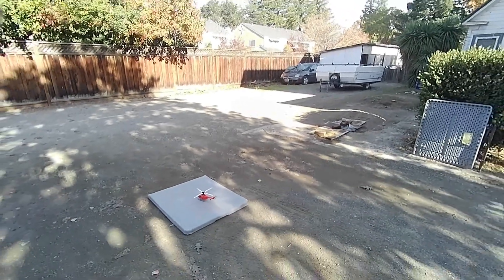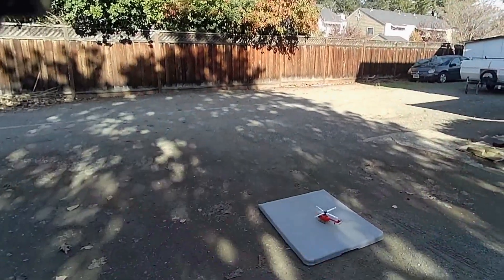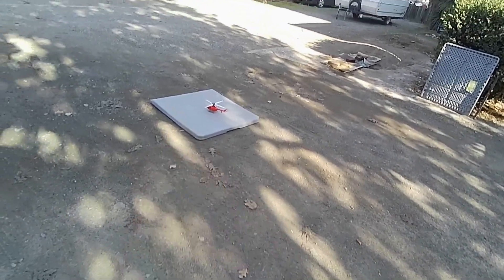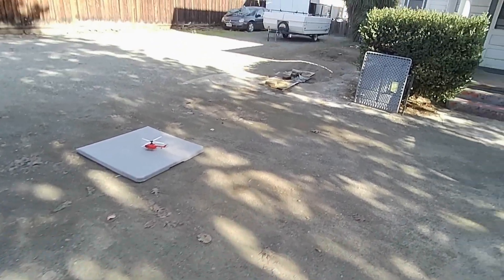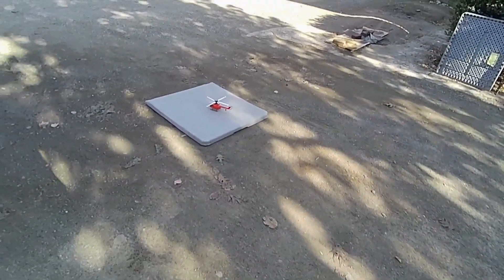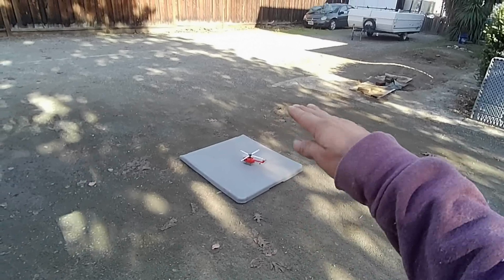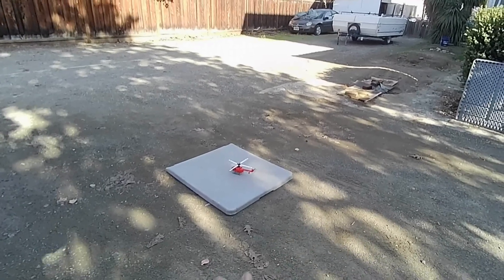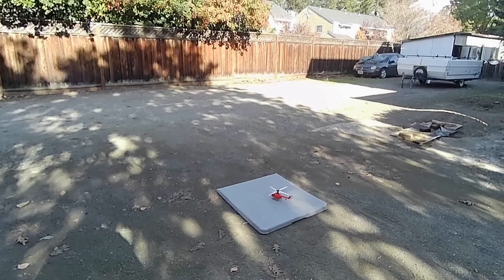You've seen my previous flights with the four-rotor head — it was always unstable and would not settle down. Then I tried it with the two-blade head and it flew nice, so that told me there was a problem with the head. After some other tests, I pretty much concluded this was a blade grip problem. So I got the K124 grips and adapted them to the C186 head. Now the blades move very freely and feel nice. I did some runups on the bench to make sure everything was balanced — had to put a little piece of tape under one blade. Now we're gonna see if it's gonna fly or fly sloppy.